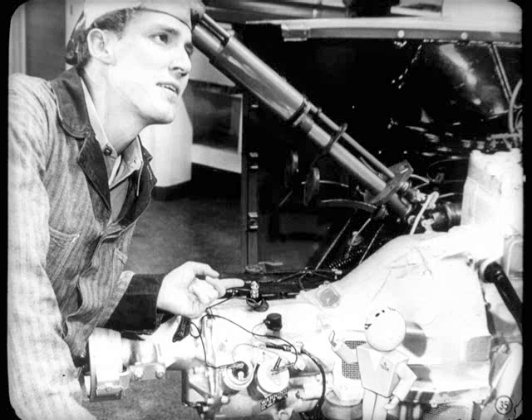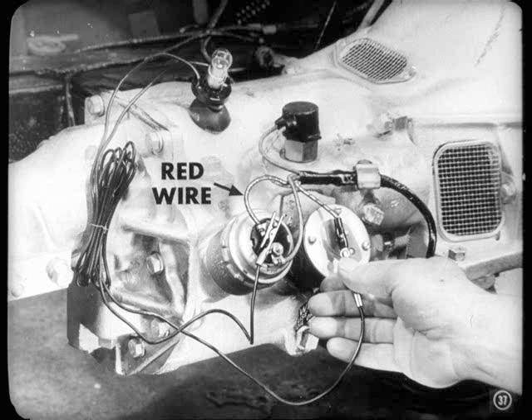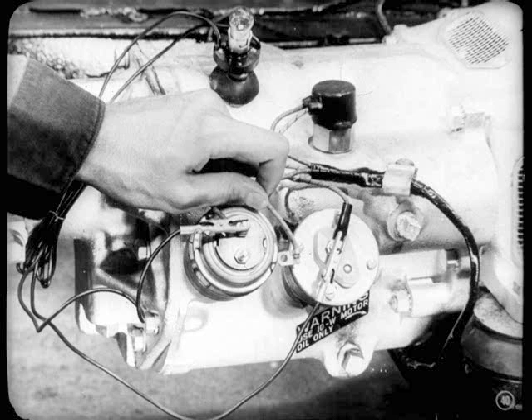You can check the circuit by disconnecting the wire at the governor terminal. Connect one lead of the test light to that wire and the other lead to the red wire terminal of the solenoid. If the light goes out, the wiring is okay and the trouble's in the governor. But if the light doesn't go out, you know there's a ground in one of the yellow wires, so you'd check the wiring to the interrupter switch, the kickdown switch, and to the anti-stall control. If you disconnect the yellow wire at the solenoid and the light goes out, you'd know that there might be an internal ground in the solenoid, so you'd have to replace it.